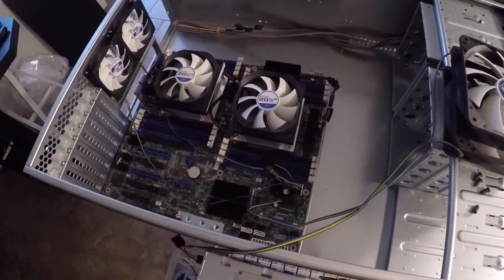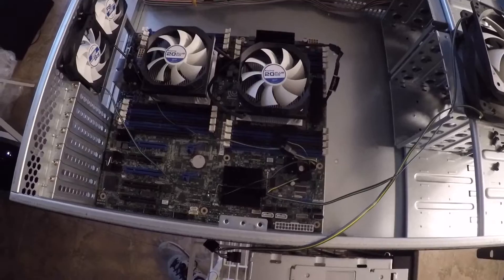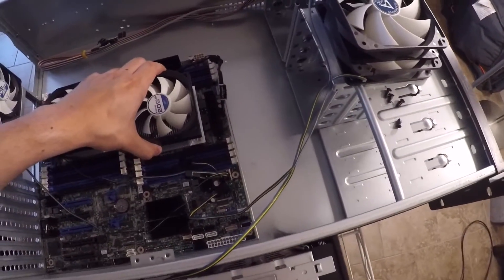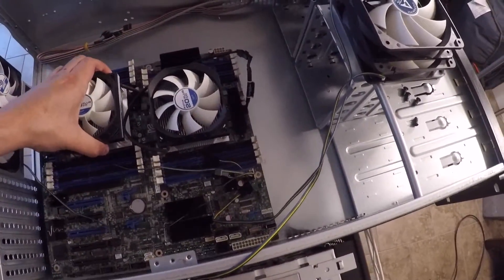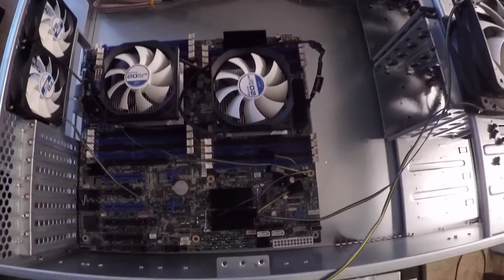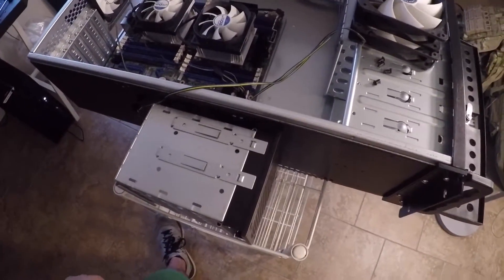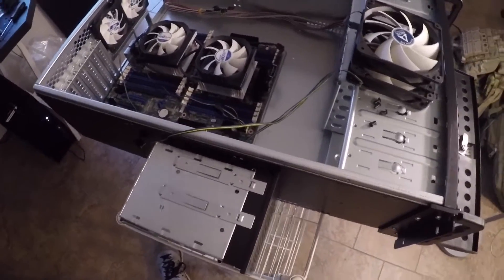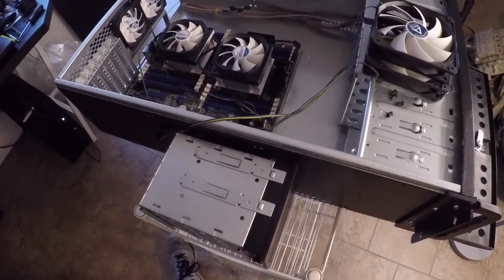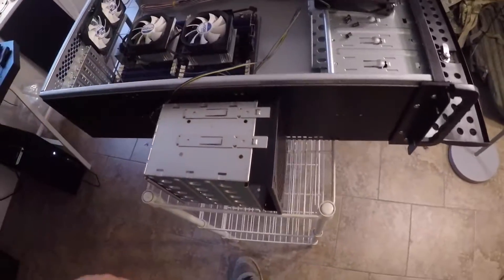This is the infamous Intel S2600CP motherboard. I just need to put a power supply in — I haven't mounted this down yet, but I lined up all the standoffs except for one that needs to move. I like to open up the case, strip out the parts I don't want, replace the fans, get the motherboard standoffs situated, and then drop the power supply in before I mount the motherboard. That'll make it a little easier to screw everything in on top.